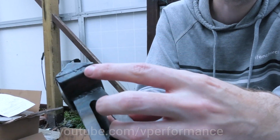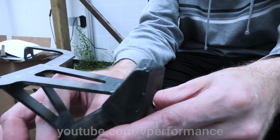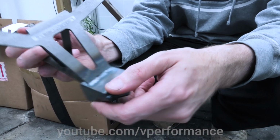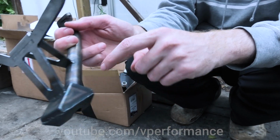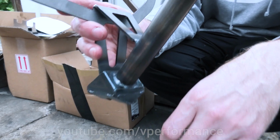I mean, you didn't even take the spatter off it. Yeah, so it's still spattered. And it's not welded on both sides either, is it? Straight lines. You tout this thing and you've welded that half. You've not welded the back half. You've welded that half. You've not welded the inside. You've left a honking great big gap at this side.